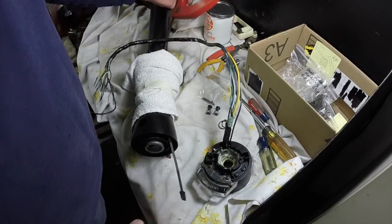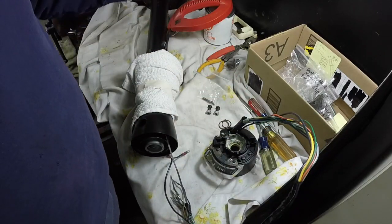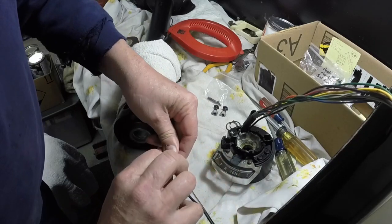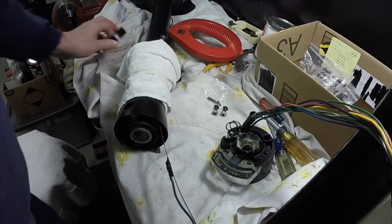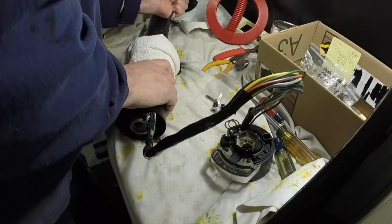I might illuminate it just to see how it looks. I put my thumb over that because the light bleeds out around it, but it actually looks really good - it's not overpoweringly bright like before. It's probably about equivalent to the rest of the dashboard in the car. I'm happy with it - I wanted to make sure if there's any issue with how it illuminates, now is the time to correct it rather than when it's all together in the car. You can see how I just shoved the fish tape through here, then I can pull the wiring back through. I'll attach the wiring to the fish tape with electrical tape. When you tape this stuff up, pull your tape tight - it'll hold better and take up less space. I like to fold the last little tab on itself so you have something to grab to untape it.